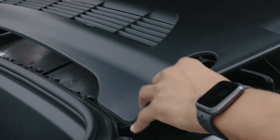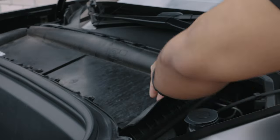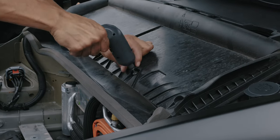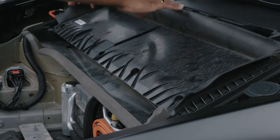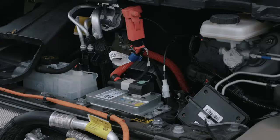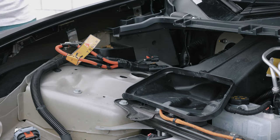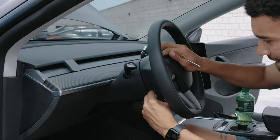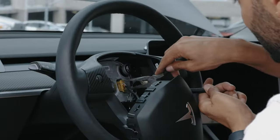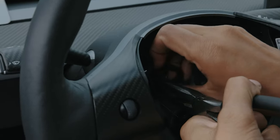To start out, we have to take the tub and the air filter out of the trunk. As you'll see throughout this video, we're kind of doing a lot of trial and error because there were no instructions with this — just bear with us. Here we're taking out the 12-volt battery and the main power supply. Very important. Right here we are popping out the airbag and disengaging it. Don't need that thing blowing up.